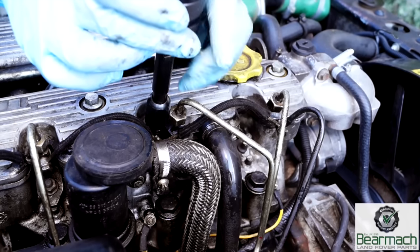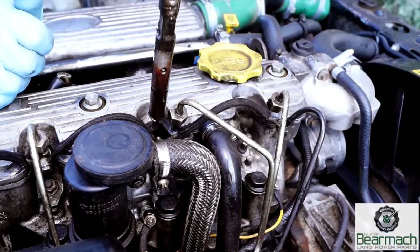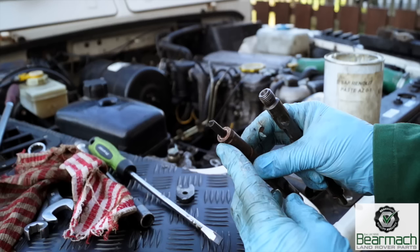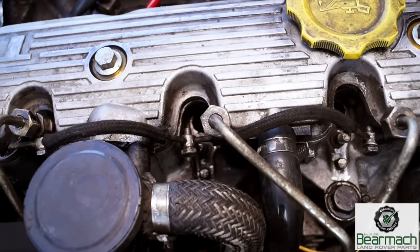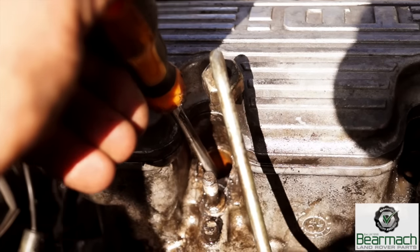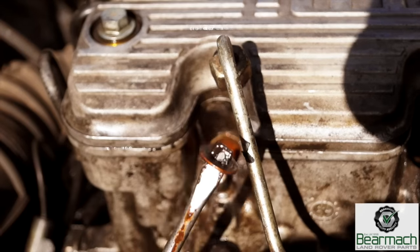Using an impulse extractor — you could also use a spanner and wiggle it until it cracks the carbon off. What we want to do is draw out the first two injectors, and looking on the end you'll see there's a copper washer like so. This will always need to be replaced. Never use a secondhand injector washer because they do not seal. The injector seats should be clean and free from debris — it's good to blow them out with air. Do not pour liquids down there. Injector seals you have to remove somehow if they're stuck in there. One way to do it is to push a screwdriver in it, turn it, and then lift out the copper washer.